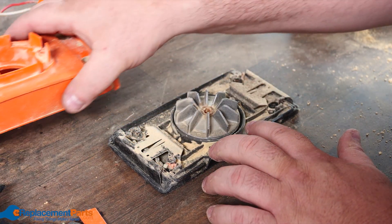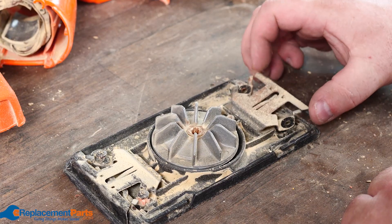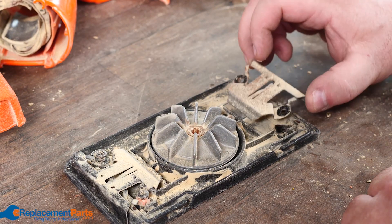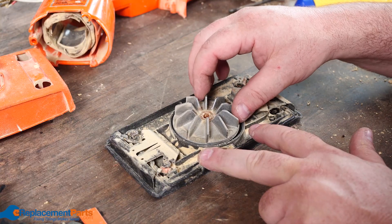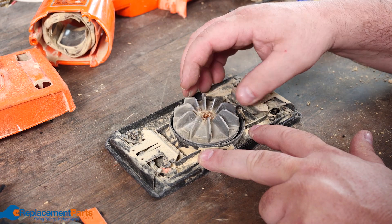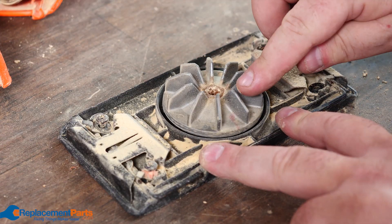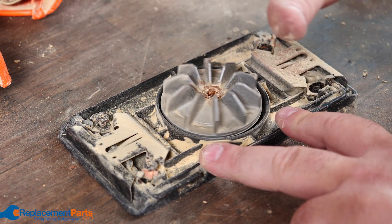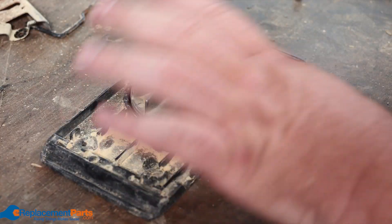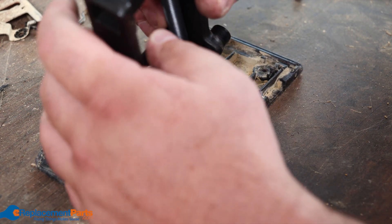Once you remove that cover fully, we're down into the base. Here we have our locking mechanism for the sandpaper on both sides, and then we have our spinning flywheel — you can see it's offset. In this case there are also more blades to create a bit more cooling and try to blow the dirt away.